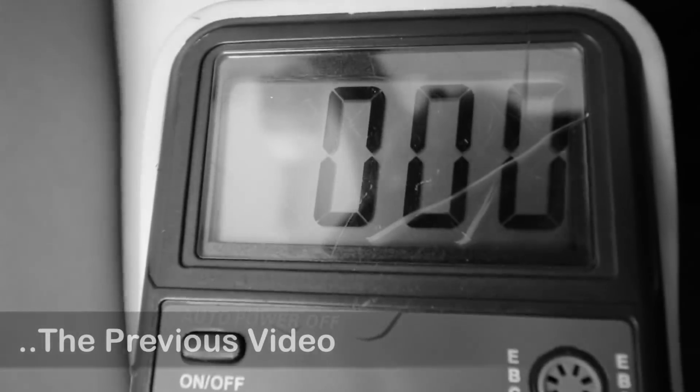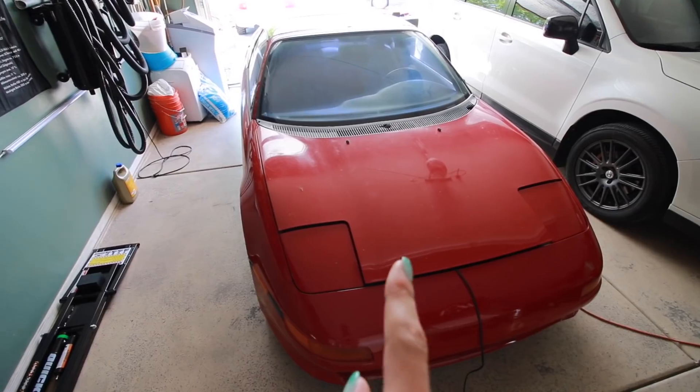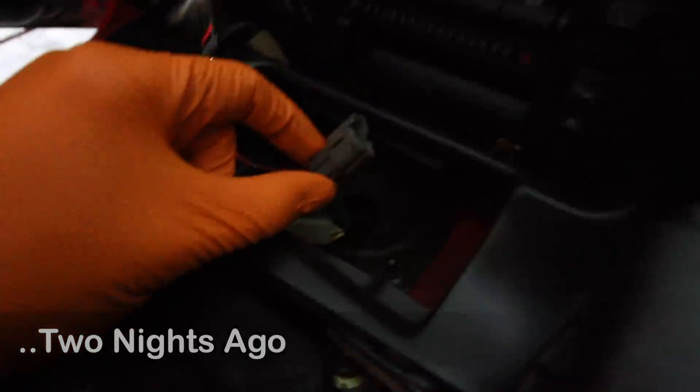That is continuity to ground where I should have power for the fuel pump circuit. I just got back from dropping off Junkyard Dave — if you don't know who he is, he's another automotive YouTuber who flew down to help troubleshoot this electrical problem. First plan of attack: run power to the fuel pump, then a ground, and jump the fuel pump. The fuel pump is unplugged right now and Dave hooked up a wire to a 12-volt source, and you can hear the fuel pump running in the background.